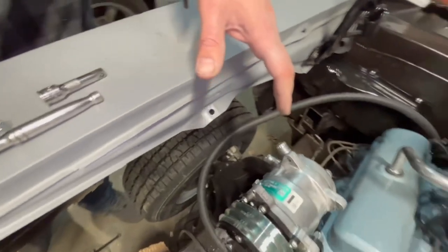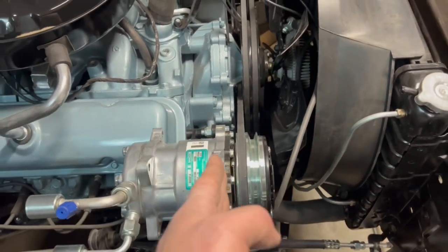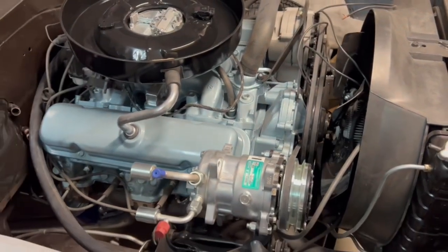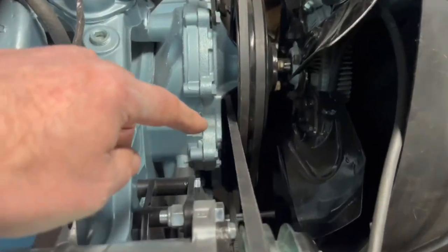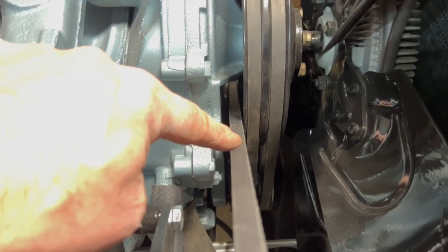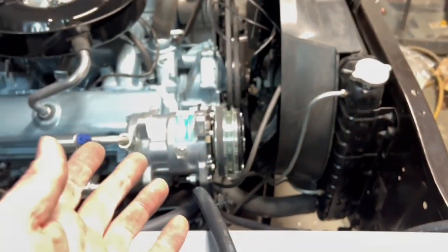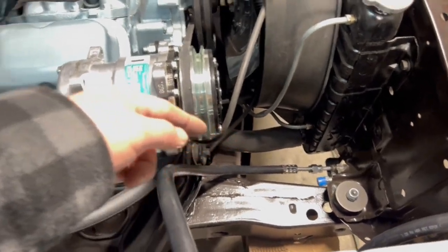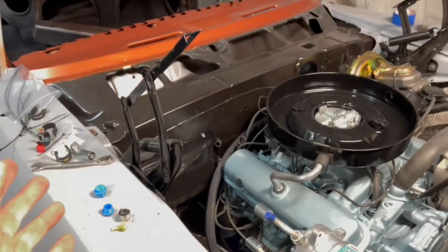I went ahead and slapped the belt on. Look at this — shooting straight down from the crankshaft, there's no deviation at all. Great alignment. But this is a 1968 first-gen F-body front end drive, and I've never installed a '68 Vintage Air kit before — I've done the '69 a couple of times. Looking at it here, it's really close to the water pump pulley. There is a gap — trust me, it's not touching — but it is very close. If you're running into that on yours, let me know. It's going to work and it will clear, but man, that's tight. You can also start to see some AC system line fittings here — I'll be working on getting all that plumbed up.